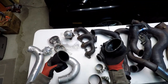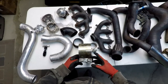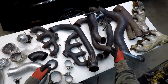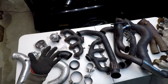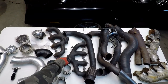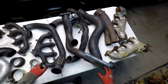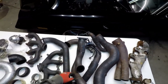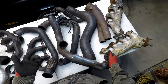Some silicone couplers — looks like throttle body to three inch. Another elbow here looks like a three inch elbow, a bunch of band clamps. Various hot side piping as well. He's used what looks like sixth gen Corvette manifolds — I'm not sure if these are off of an LS2 or an LS3 car. But I can already see an issue: if this is the driver's side facing forward, this is already going to dump right at my master cylinder, so we're going to have to maybe change that. This is where your wastegate would go on your merge just before your turbo — it's a T4 flange because I have a T4 turbo. We've got a merge to your exhaust, a four inch dump pipe going down.